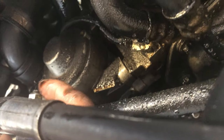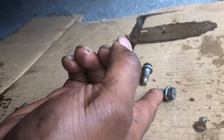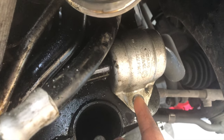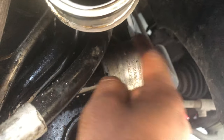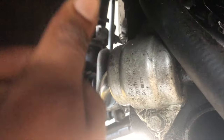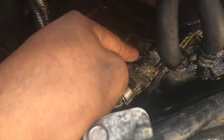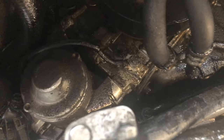We're going to remove the power steering hose off the bracket, which is right here — hold up here at the top and then down here just to remove it off of this. Went ahead and took these two out — they're 13 mils. So we're dropping the sway bar. Here and here's the bolt, and right above up here is the other one. I'm going to go ahead and use the E12 and remove this first, and then after that with the E12.